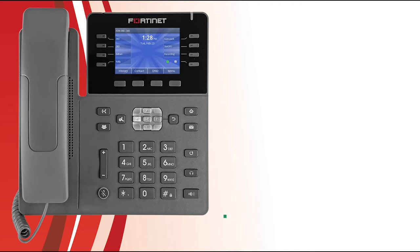Starting with outgoing calls — aside from the obvious method of simply picking up the handset and using your dial pad, you can place an outgoing call to an entry within your call history by pressing the History soft key, selecting the entry to call, and then pressing the Dial soft key. For hands-free, select the Speaker button, or for a Bluetooth headset, select the Headset button.